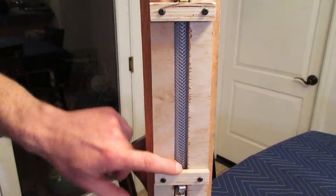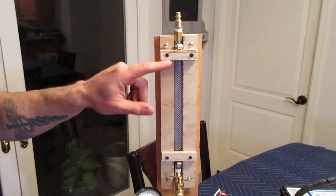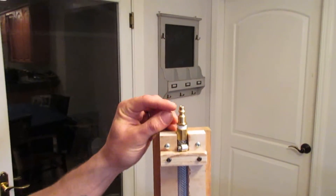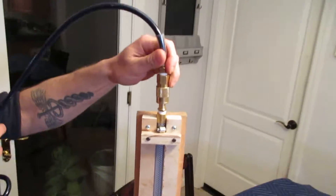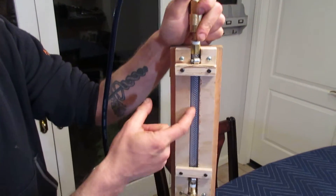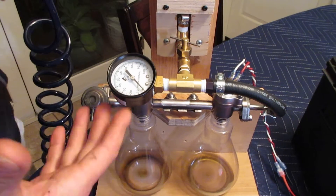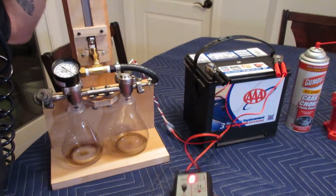This is a big high-pressure clear tubing rail which I'm going to fill up with carb cleaner. The general idea is we fill this tube with carb cleaner, meaning there's carb cleaner going through all the brass rail, the fuel hose, and the common rail. Then with this air hose fitting, I connect my air hose and apply 25 to 30 psi of air pressure to the column of carb cleaner. We can monitor the pressure on the gauge — it should be about 20 to 25 psi once everything is set up.